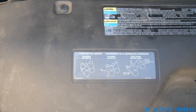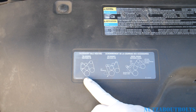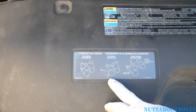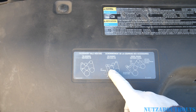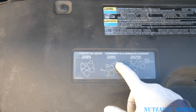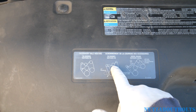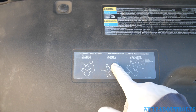Now it's time to put back the serpentine belt. This is a V8 engine, not diesel or V6. You can find the belt diagram label on top of the radiator cover — it's plastic. I'm going to loop around the crank pulley, the water pump pulley, the power steering pulley, the alternator pulley, and the auto tensioner pulley. When I pull the auto tensioner to the right, I'm going to loop the belt around the idler pulley last because it is a smooth groove pulley, so it's easy to put in.